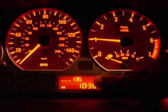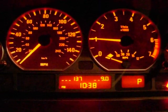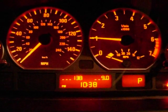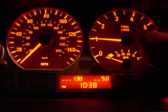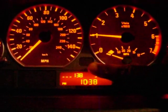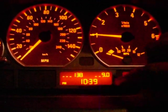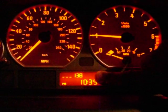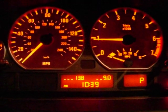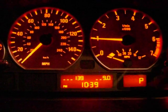So it's going to go up. I believe that number should be in the 14s. On my other car — my E36 1995 3 Series — when it broke down and I put a new battery in, this number always used to be 14. The OBC control on the E36 cars is actually down beneath the radio. I think once the car is started, let's give it a little gas — yeah, that number should actually be 14.7.